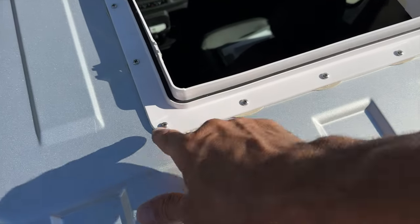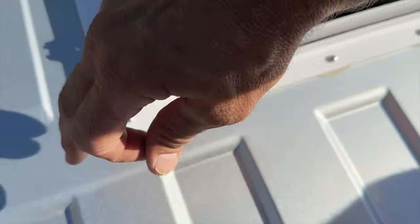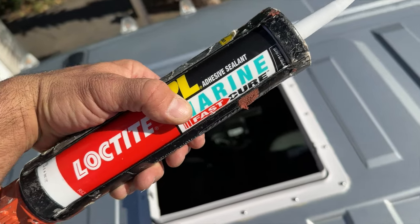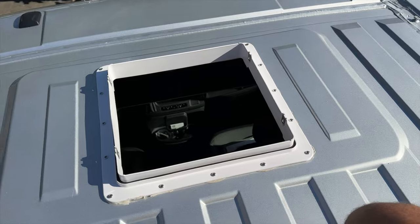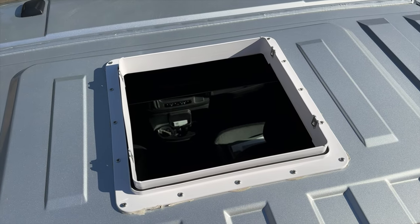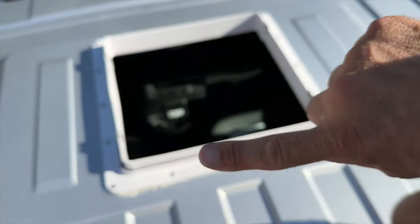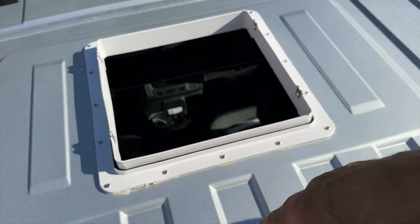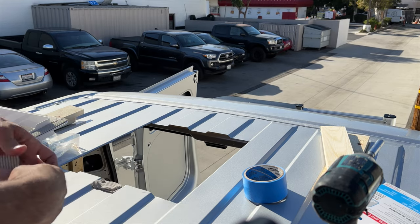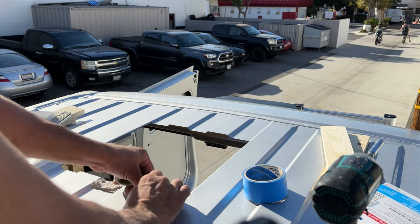It's all screwed in now. Go around and clear off any of this extra butyl tape that squeezed out, then tape it off with some blue tape and seal it with marine sealant — I'll put a link for this as well. You can also use a lap sealant, but I'd recommend the marine sealant because the lap sealant is self-leveling so it drips all over the place, whereas the marine sealant is a bit thicker and with gloves on you can put it exactly where you want with your finger. Here in the back because of the grooves, you need to put one layer on the flange and then two layers on the bottom pieces.